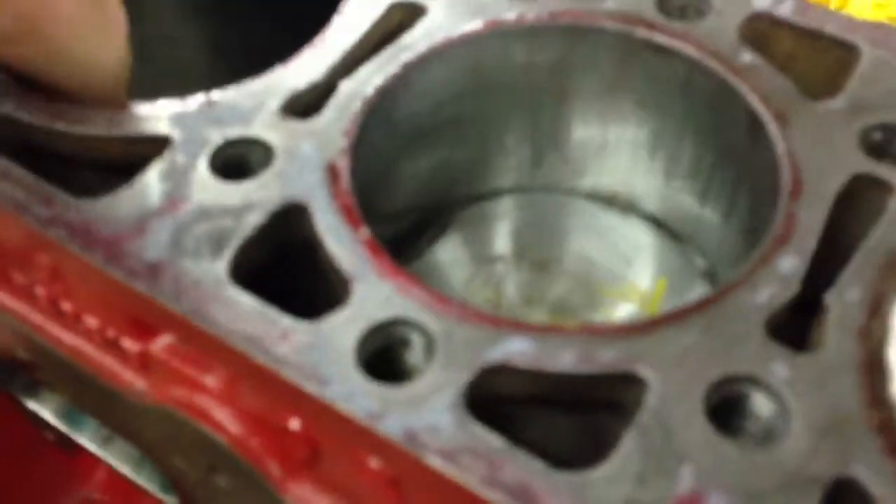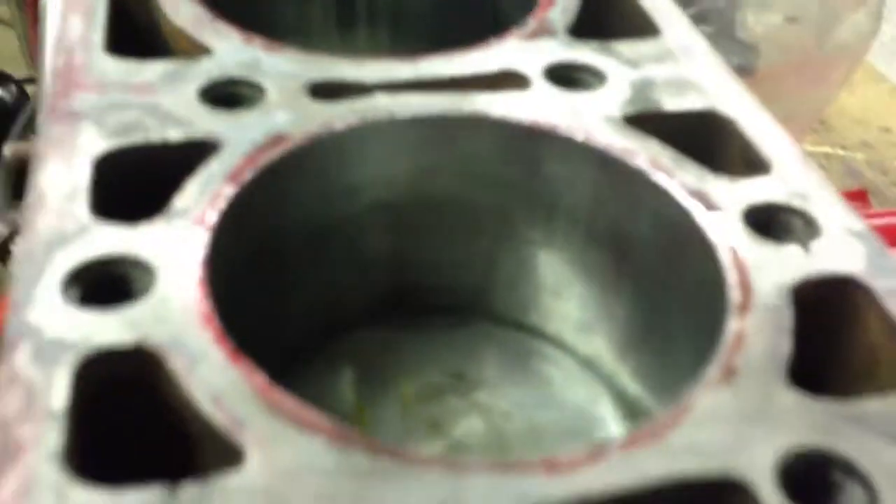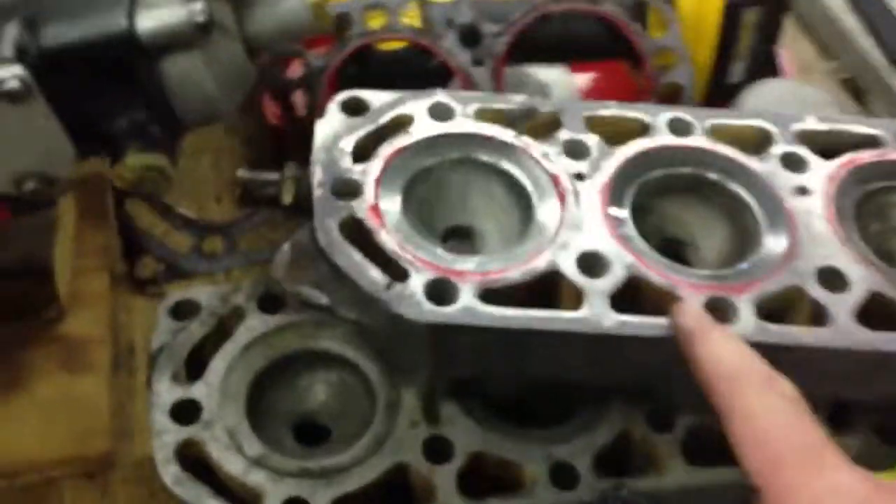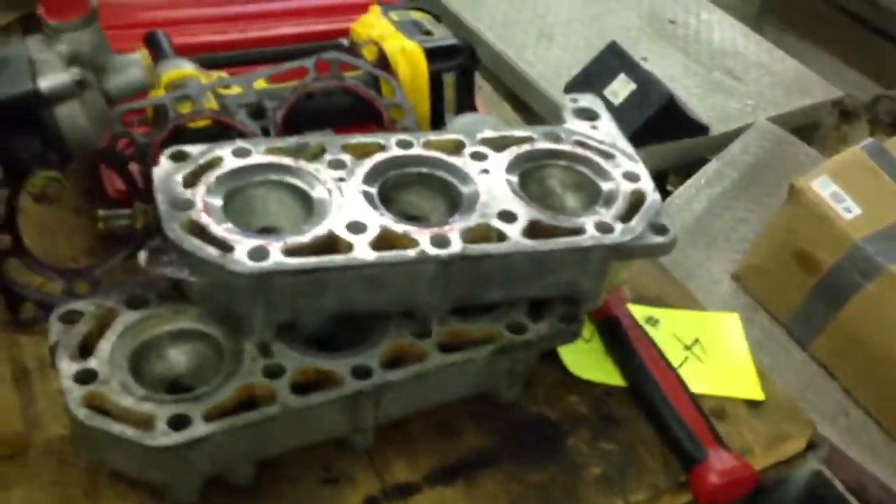With new rings on there — take a look at this one. I'm going to bet that's from the kissing and banging where it put a little bit of a groove in the sidewall. But we'll get that taken care of, get some good rings in there, and get the head relieved. Might put a Monte Carlo head with it, not sure yet, or might just leave the block as it is — but it shouldn't be a hard fix.